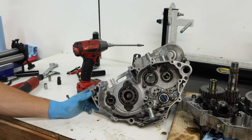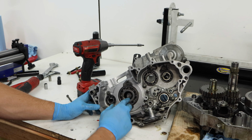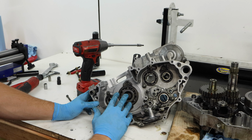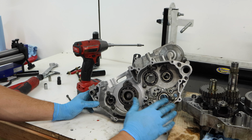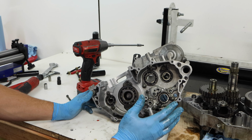Alright, so the next step that we're going to take is, since we know for sure we have to replace the crankshaft, we're going to replace the main bearings here as well. So I'm going to go ahead and take those out today. I'm also going to take out some seals and stuff, but I'm going to leave in every other bearing for now, and I'll show you guys how to inspect that in the next video, and then we'll actually see which ones we're replacing then, or if we're replacing any.